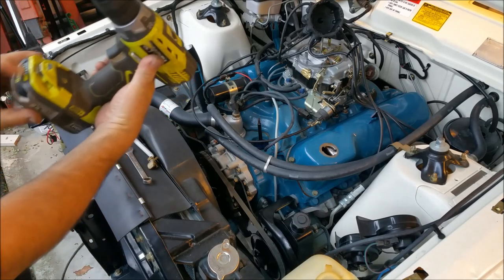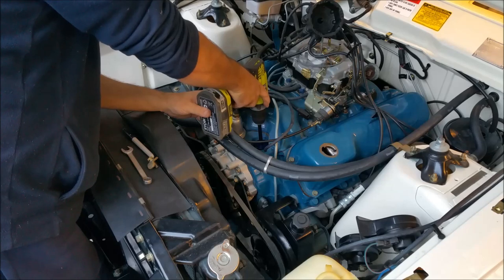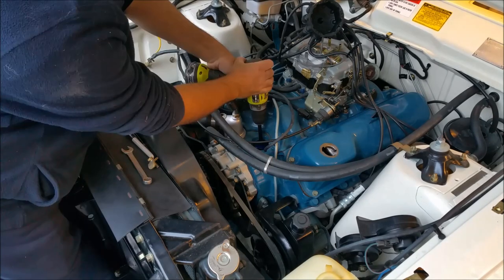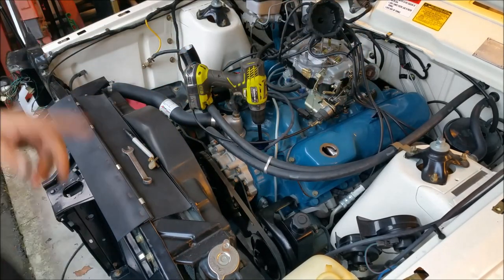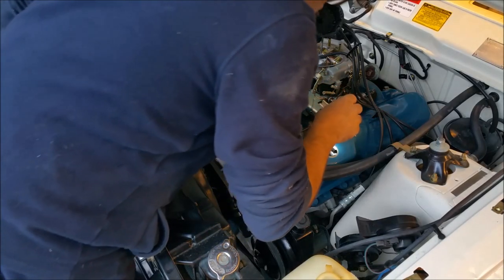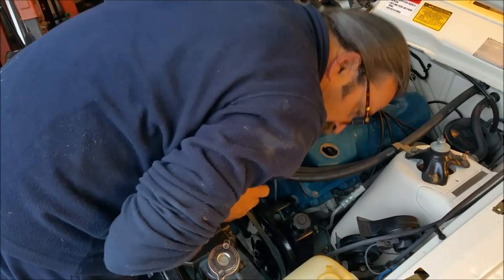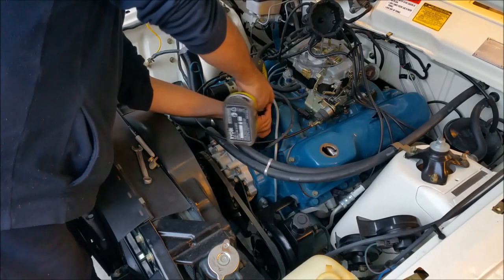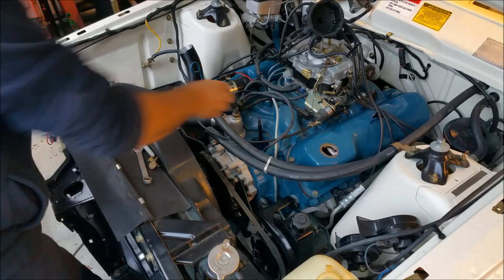This needs charging, I think. Hang on. Oh, no, we're on 3 bars. That's not terrible. Got oil pressure already. Yep, it's all gurgling away and looking good. I'll just get a torch and have a look to make sure there's lots of oil going around in the top end. That's actually really good. Yep, that's doing what it should. Look, it probably wasn't even worth doing that. But better be safe than sorry. And that sort of guarantees that you've got oil in your bearings and that sort of stuff, particularly if you haven't run the thing for ages.